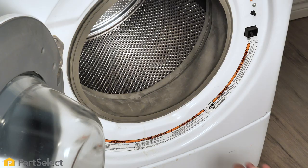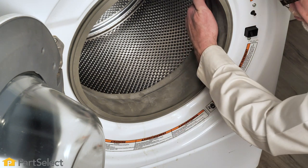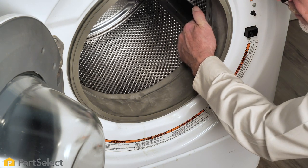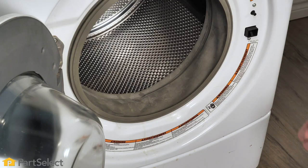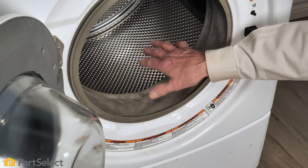Based on the type of sound that they make, will dictate where we go looking to find those items. If we're getting a scraping sound when we rotate the drum slowly, and there's more of a metallic sound, we might suspect that we've either got a coin jammed in there somewhere, a small finish nail, or a bra wire — something metallic that has gotten between these two tubs.